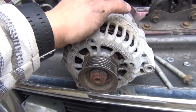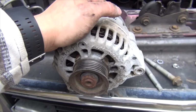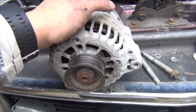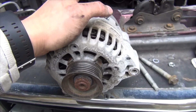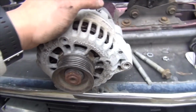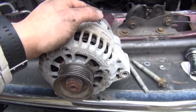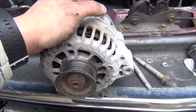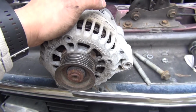But what I see instead is it drops right down to, that one time kind of scary, 11.5 volts, and I was going, oh crap, I'm going to be stranded. And then I basically whacked the alternator. Not the best thing to do, kind of like a starter, and it went back up to 13, not 14. I was expecting to see 14.5, 14.8 volts for charging.